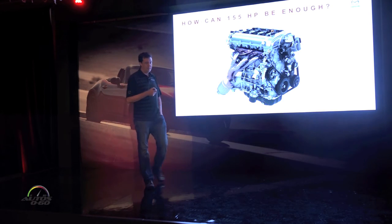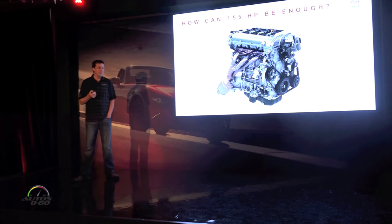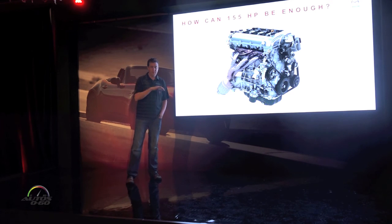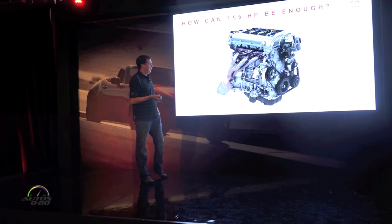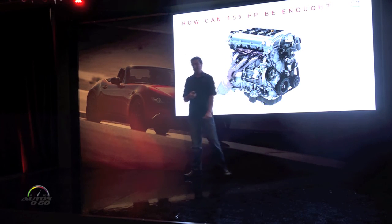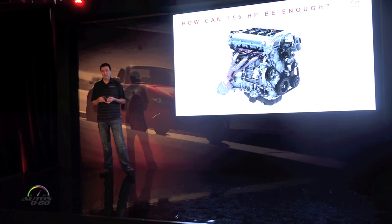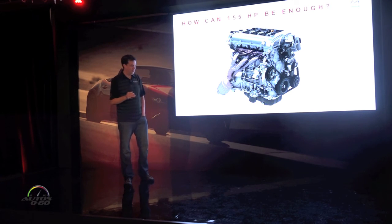Finally, the engine. This is the same Skyactiv 2-liter that's in the CX-3, the Mazda 3, and the base CX-5. You won't necessarily recognize it as the same engine because we tuned it very differently here. Internally it's exactly the same; externally we changed the intake manifold, exhaust manifold, and the oil pan, along with a little bit of the cooling plumbing around the outside. The single most important change we made to this engine is right here — the valve cover is aluminum, because in a sports car when you open the hood you should not see Tupperware. We actually spent more money and added a little bit of weight simply so the engine would look right when you open the hood.